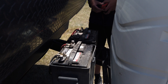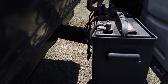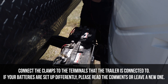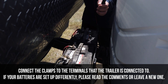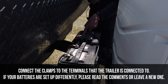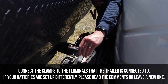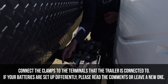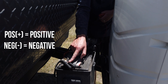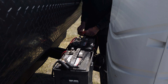What I have here is two lead-acid deep cycle batteries, connected in parallel, which means the negatives are connected to each other and then the positives. What you want to do with these clamps is put them on the terminal where the trailer connection is being made. I can see there are two connections on one side and only one on the other battery, so that tells me this battery is connected to the trailer. I'll put the negative clamp there — your battery will have a marking like 'neg' or a minus sign. Then take the red clamp and put it on the battery where there are two connections on the positive.